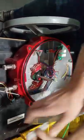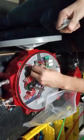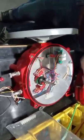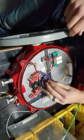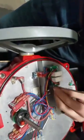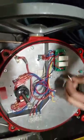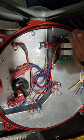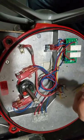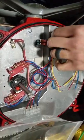You generally save all these things, so that if a customer comes in needing an IRB board, we'll have the entire kit to replace anything in the actuator on them requesting it. So next we take out the IRB board itself, which is four screws with posts underneath the board, keeping it up off of the deck and the inside of the actuator. The posts are not glued or anything, they just come right out. They will run away from you, given the chance.